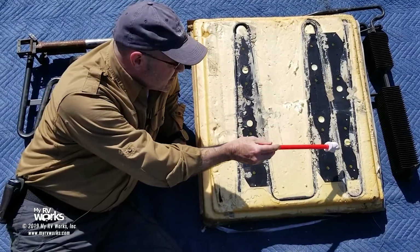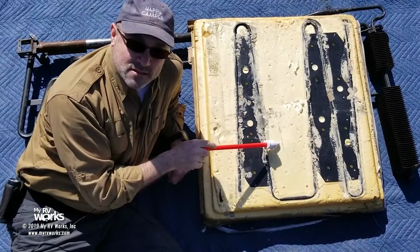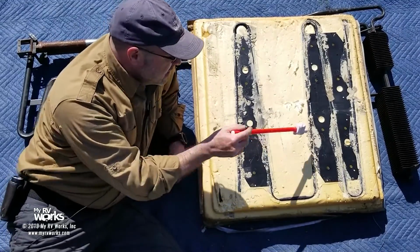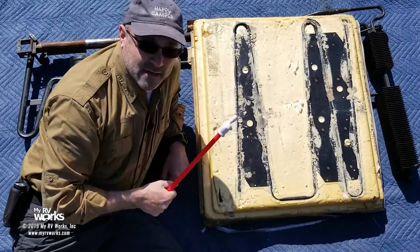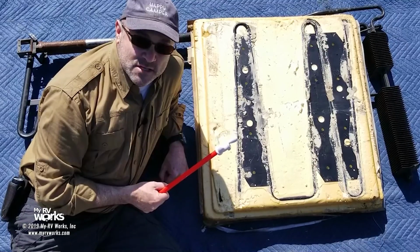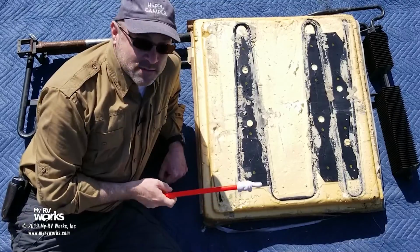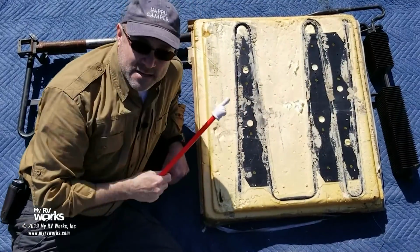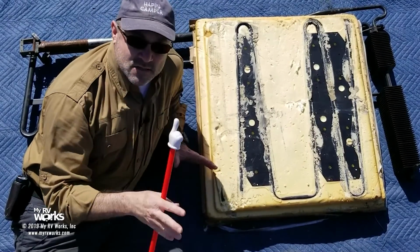But what you're going to see, I'm just going to go over this really quick, because Dakota and I have taken all the foam off of this to show you the guts inside of here. We've skinned it and cleaned it, right? Okay, and so the coldest part is going to be coming up here. And when that ammonia vaporizes, remember we were talking about the vaporization pressure being minus 28, and even colder sometimes? That's this spot right here. And so it works its way down, and as that ammonia vaporizes, the heat is absorbed around it.